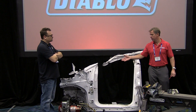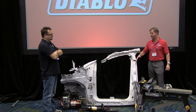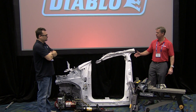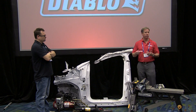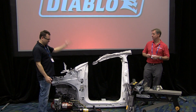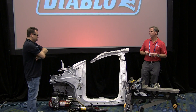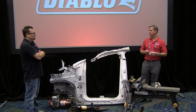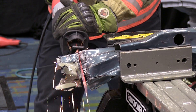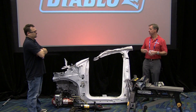What they're showing here is that jaws of life are not a viable option for cutting advanced steel — most are too antiquated, too slow, and can't get through the job. Systems cost three to four thousand dollars, and even newer ones capable of cutting it run five to seven thousand dollars. With a simple carbide-tip metal cutting blade at ten dollars retail, you can zip right through it. The reciprocating saw is already on site for fire and rescue and auto dismantling crews — just buying a ten-dollar blade and they're ready to go.